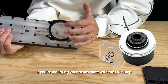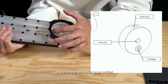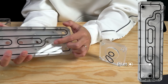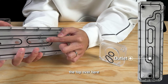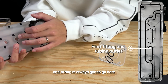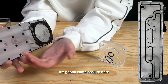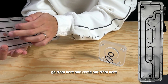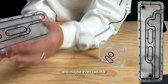If you're mounting your distro plate with the D5 pump, the hole in the middle center is your inlet and the one on top is your outlet. So since the center part is your inlet, your fluid will always come back here and always come out from the top. Your fluid goes up to this hole, so your first tubing and fitting always goes here and it's either going to go to your CPU or your GPU. Then once you route that into one of your components, it's going to come back here.